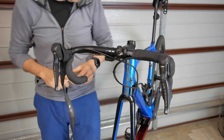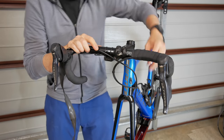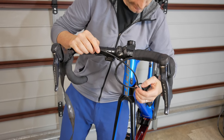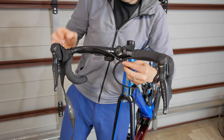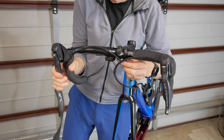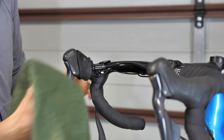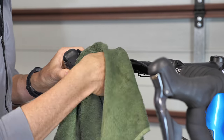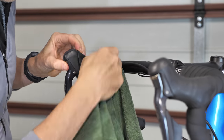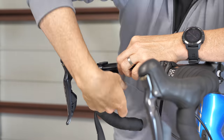A quick squeeze test before we start the — I guess you'd call it a half bleed — to get all the air bubbles out. Just checking the routing again here to make sure everything is okay. Not quite sure that's going to be the final form I'll stick with, but we'll see how it goes. Cleaning everything up with a bit of rubbing alcohol, just to make sure there's no hydraulic fluid left over that's going to stop the bar tape from sticking.